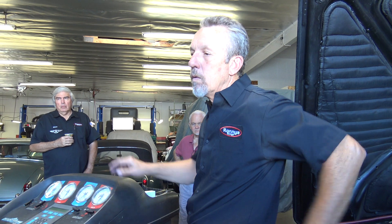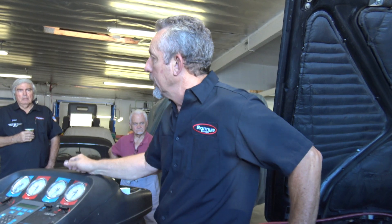On the 20,000 series they went to the smaller Sanden style compressor. It's more efficient, lighter weight, uses less Freon — that's the reason for the change. This old compressor is gigantic, but things improve. The ones on modern cars are almost space age: super small, super low capacity, with variable output — totally different. This GM or Harrison compressor is still available new but it's expensive; you can buy a lot of rebuilds. The newer smaller aluminum Sanden-style ones you can buy brand new, cheap or good quality.